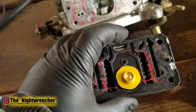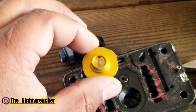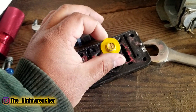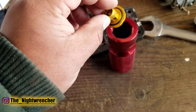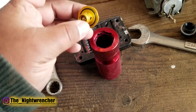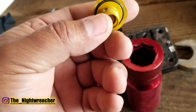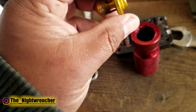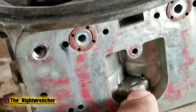I'm removing the power valve to show you something. I've unscrewed the boost-activated power valve — it's significantly smaller and looks different than a traditional power valve. My only major complaint is that a standard wrench won't fit it; I tried a one-inch and 24 millimeters. I have a Proform power valve removal tool but it won't drop in, so I'll shave it down on my bench grinder. This power valve is also sealed with an O-ring instead of a paper gasket, which seals better.